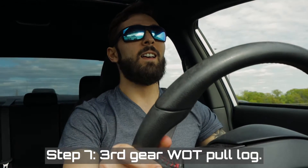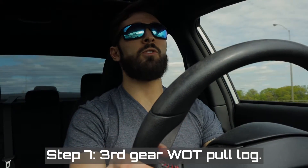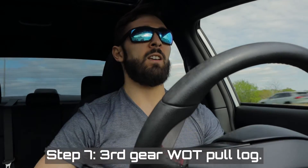That pulled super hard — I got a nice clean opening in traffic, absolutely perfect. Started at 2k RPM, all the way down on throttle exactly how you're supposed to. One of the biggest issues tuners mention is that people don't give 100% pedal input — all the way to the floor — for the entire WOT pull. Looking at my numbers, I got a little bit of fine knock learn and DAM is still at 1.0, so everything looks good.